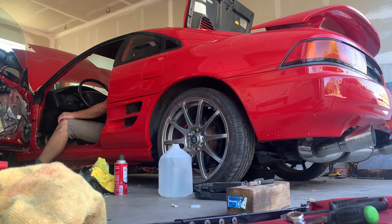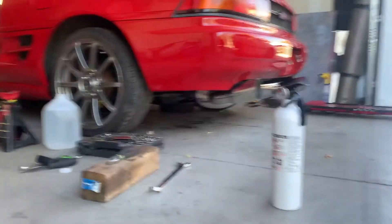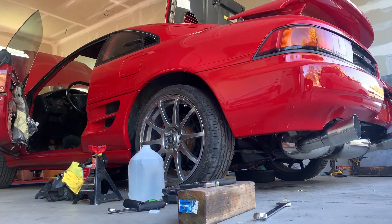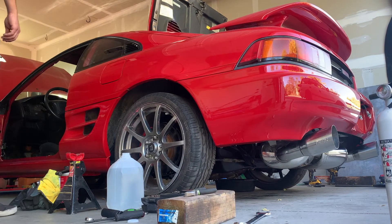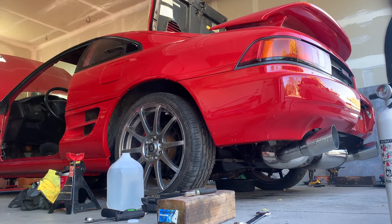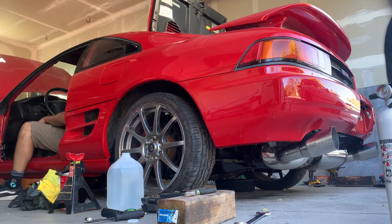No dice. I've got to plug in the crankshaft position sensor — it won't start without it. I have plenty of gas now, I have plenty of oil pressure. That's plugged in. I'm going to clear codes, because that's how I found out. And now let's try this again.